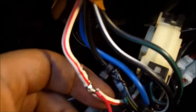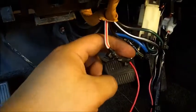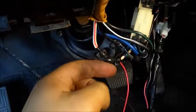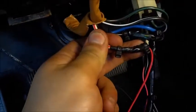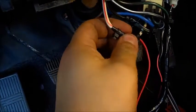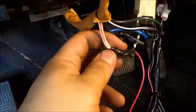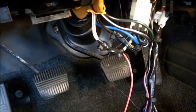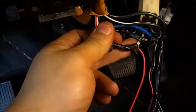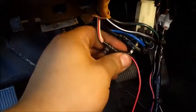I'll go ahead and tape it up. I did two layers of tape starting here, wrapped it around, and then another one going back around. Another thing I like to do — even though I'm using good 3M tape — is put a zip tie on each end so it doesn't start to unravel itself. All of this will end up taped up once I finish. I'm not going to show you every single wire being soldered because it's all basically the same: strip it, poke a hole through, test it, wrap it around, then solder it, tape it up, and do the zip tie on each connection.